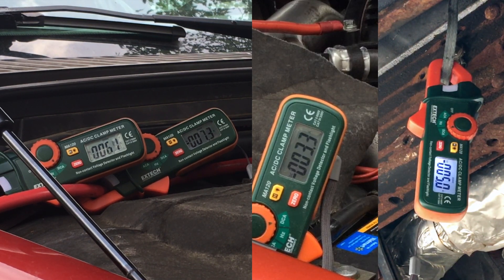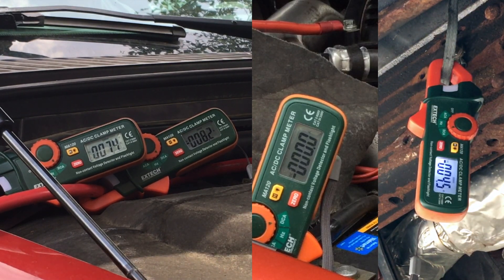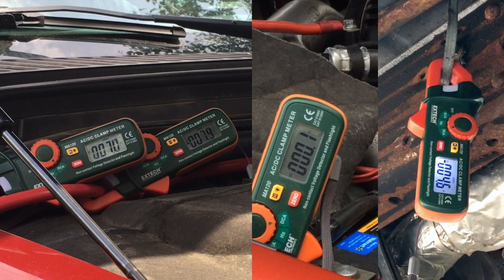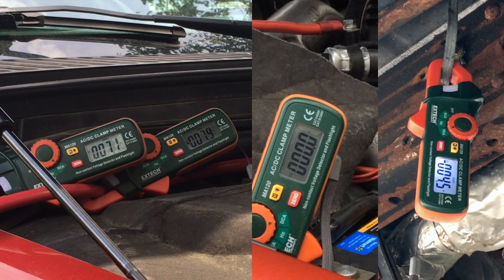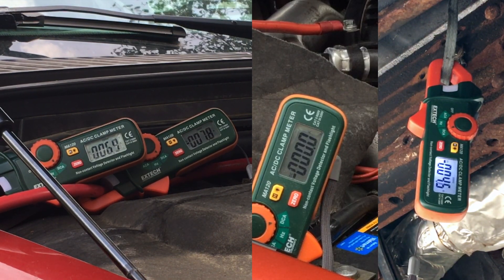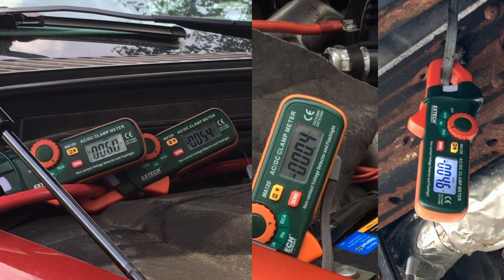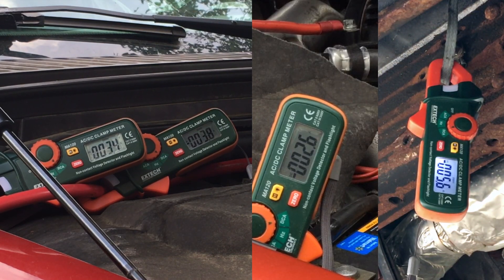It's interesting that with this cable layout, when the glow plugs are on, there's relatively no current flow through the 8-gauge cable. The flow through the motor bonding cables and the added alternator-to-fender cable is higher — the glow plugs are stalling the parallel flow through the 8-gauge cable somehow. That's the complexity of parallel circuits. And once the glow plugs are off, all four are in relative balance.